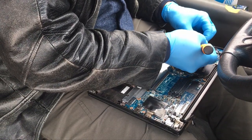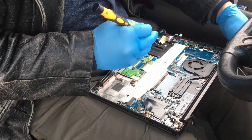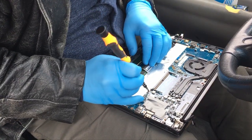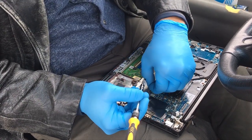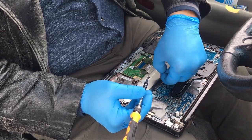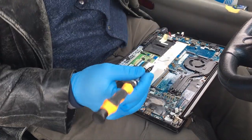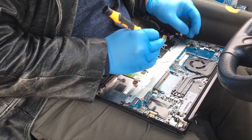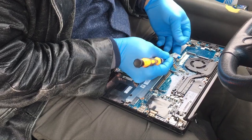You do want to pull the wires loose for the Wi-Fi card — they get seated in some little rubber keepers that hold them down against the board. Across the bottom where the RAM is, there is a little metal heat shield held by one screw on one side. Make sure you detach any ribbon cables, such as the one that goes to the touchpad, which also corresponds to the keyboard.